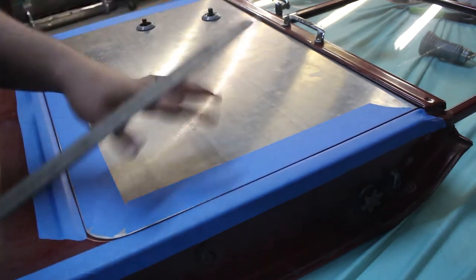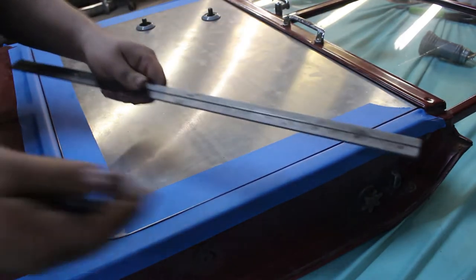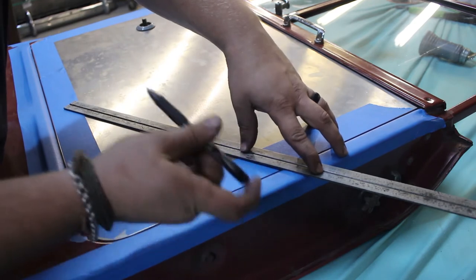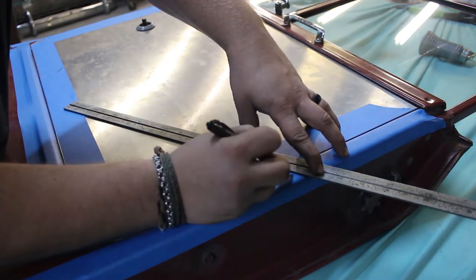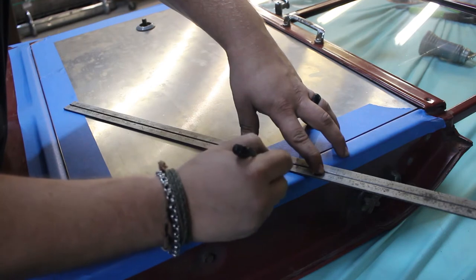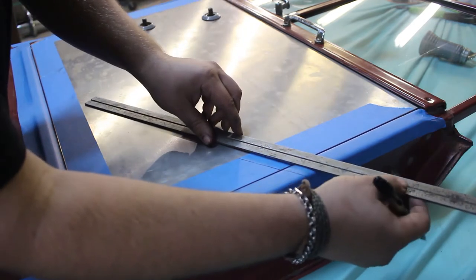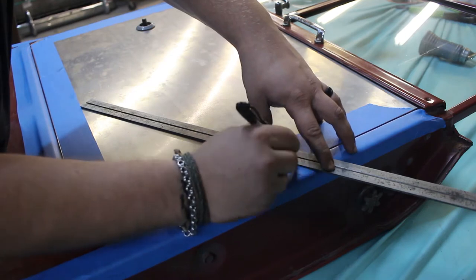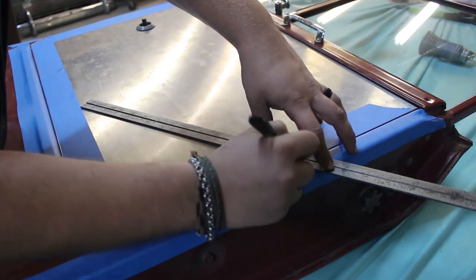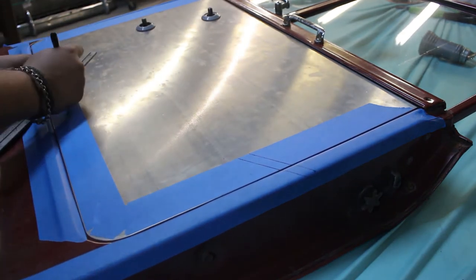Since we're going to be taking the door panel on and off through this process, you want to make lines to reference the door panel itself to the door. What I do is take a straight edge, put it at a diagonal so it won't look like any of your other lines, hold everything down firm, and just with a pen draw a line here and follow it down into the curve all the way across. You can do one, or do multiple back to back in case that one gets messed up. It's better to do this at the beginning so you don't get halfway through, misalign it, and have half your holes not line up. Continue that process for each side you're working with.